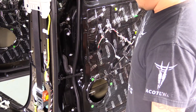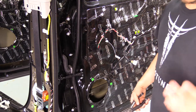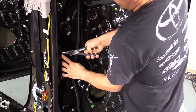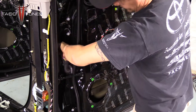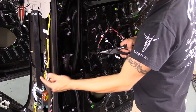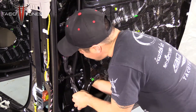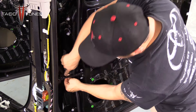We're going to start running the back passenger side speaker. Make sure everything is ready before you start pushing wires through anything. This grommet right here is where all the wires run through — we need to get through that, so remove what you can and bring it down. There's a wire harness here that we'll need to drill a hole through so we can feed the wire.